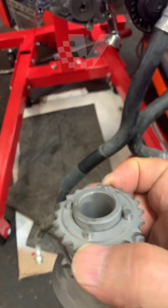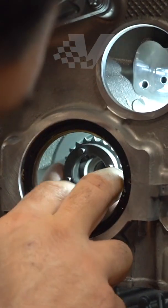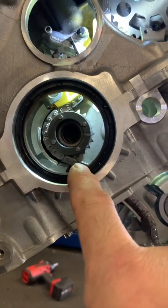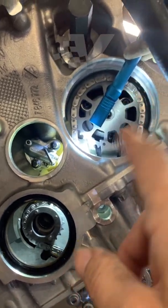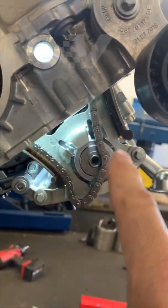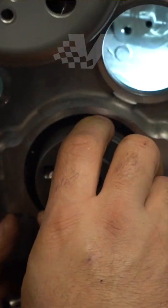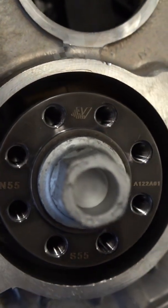Using the new dowels and pins, with the new holes drilled in the crank, everything lines up beautifully. Put the front pin in first, then press in the inside one. You'll need to put the oil pump and fuel pump chain on first since there's not much room to do it afterwards. Then the chain goes on, you can leave the oil pump gear for last, and then you'll be able to put the timing chain and hub on and put it all back together.